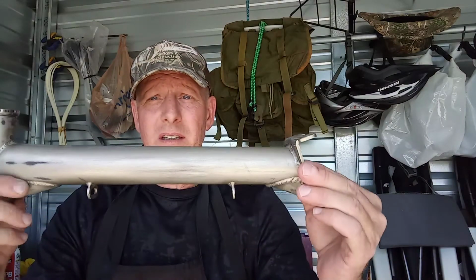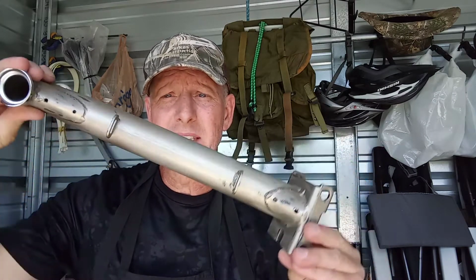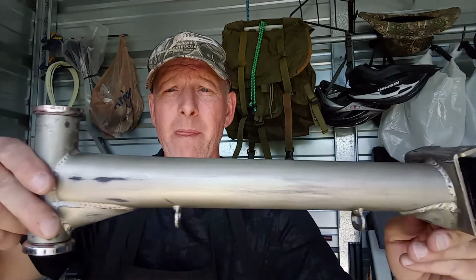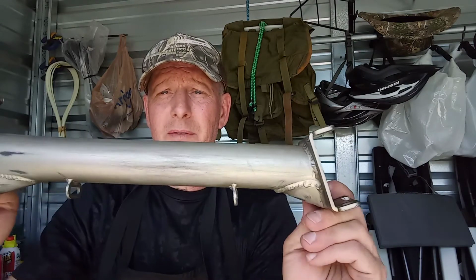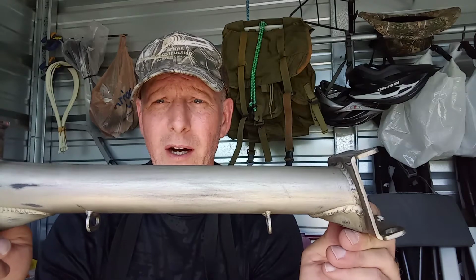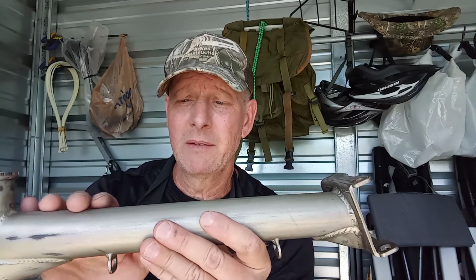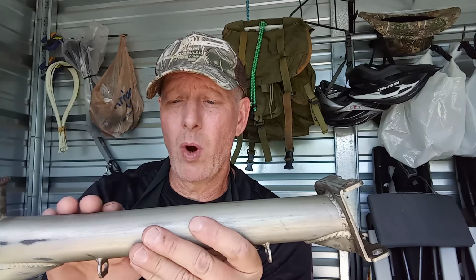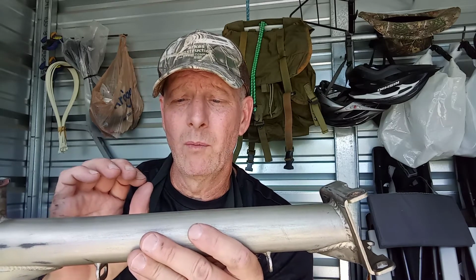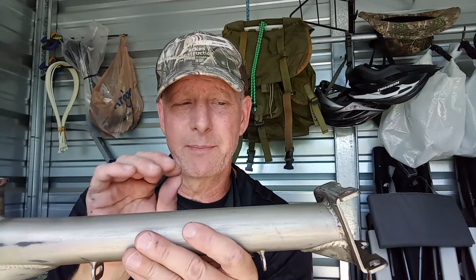So what I've done is I've taken the little folding bike completely apart, and this is part of the top tube. The little things on the bottom there, that's where the cables run through. There's the headset. There's where the hinge part goes. And I've roughed the entire thing up with 120 grit dry sandpaper to get all the clear coat off. When you're sanding, what you'll see is white dust, and that's the clear coat coming off. The reason I remove the clear coat is because I want the tape to stick to the tube as best as it can.